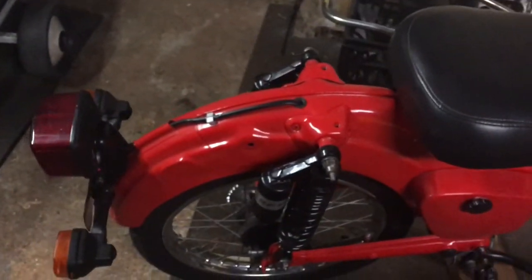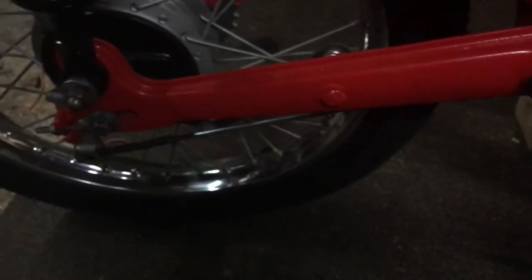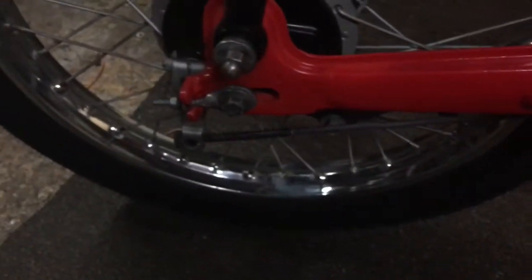The mirrors, the tail light — we went through that last time and finished that off. The other thing I've done is I've connected up this little spring in front of here onto the rear brake switch that's here, so that when that comes down it puts the switch on. I've connected the rear brake rod here, and I've just got it connected up.